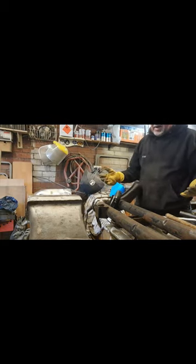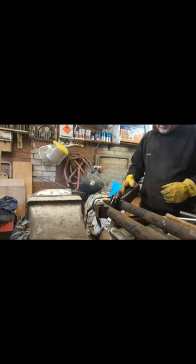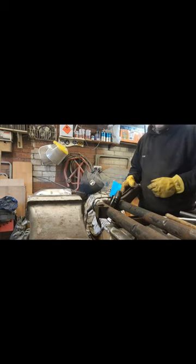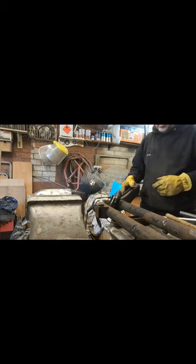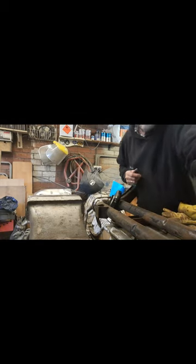So, that did not work. So that's plan A, an unsuccessful attempt to remove the bolt. So now what we have to do is grind that top off, re-drill the port hole and obviously re-tap it. So that's our next step.